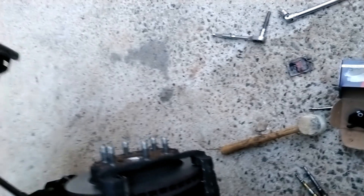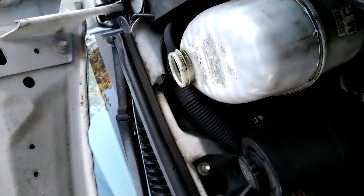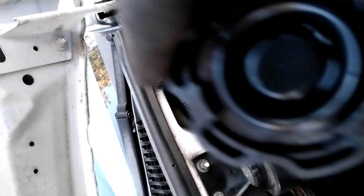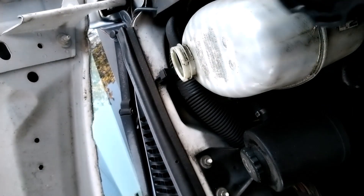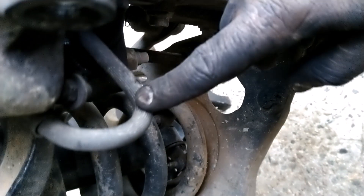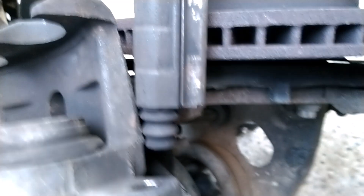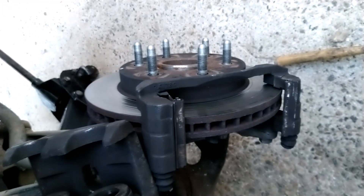One important thing: anytime you're changing your brakes you have to use the C-clamp. Before you do that, make sure you open your master cylinder brake fluid cap — see how it's open like that. Because when you use the C-clamp to press the caliper pistons, you can mess up your master cylinder or break some of the brake lines that go from the master cylinder to the tire. The brake lines push fluid to the brakes so your car can stop.